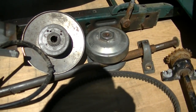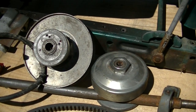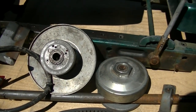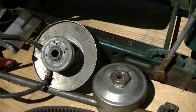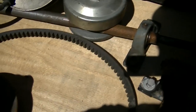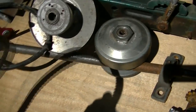I'll figure that out later because I don't have my hubs yet — those are supposed to be coming in in a few weeks. What you're looking at here is a Comet Model 40C CVT — that's continuously variable transmission. Some folks know it as a torque converter, but torque converter is not really the proper technical definition. It is a continuously variable transmission. It starts and engages at a low range of 2.43 to one and goes up to one to one, so it does give you some ratio selection. I have two belts in two different sizes and I'm probably going to use this one — it's a genuine Comet part and the CVT is genuine Comet.